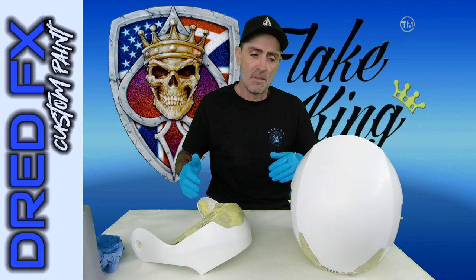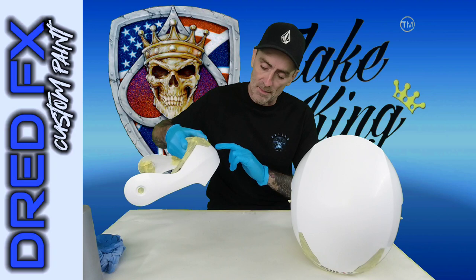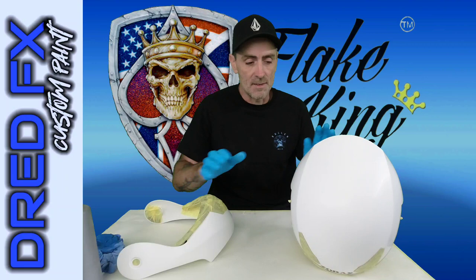I would now give this another blow off, tack rag it down to get any dust off, and then you can start putting your base coats down. On this particular lid, I'm going to plastic prime this front piece, and then this one is basically clear coated, so I'll go straight in on base coat on this.